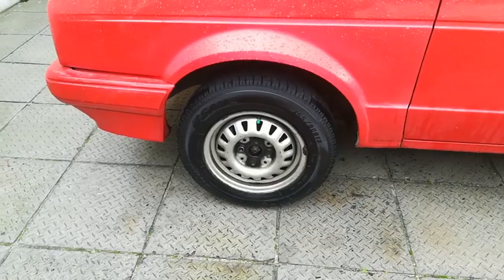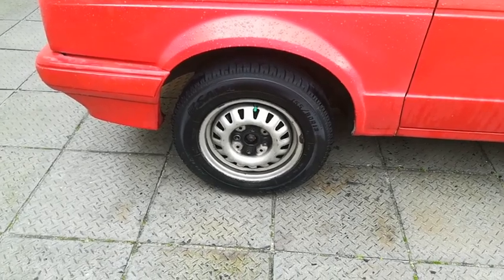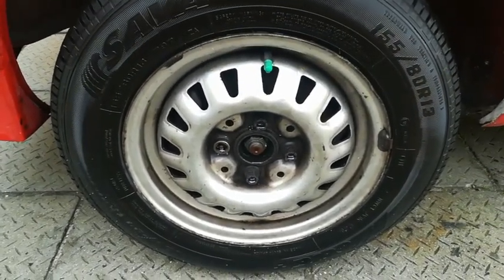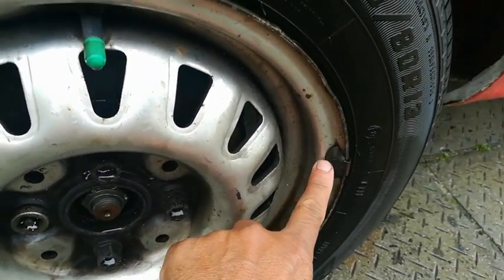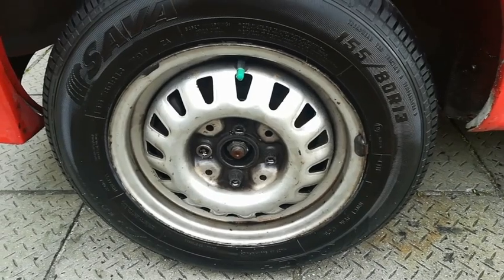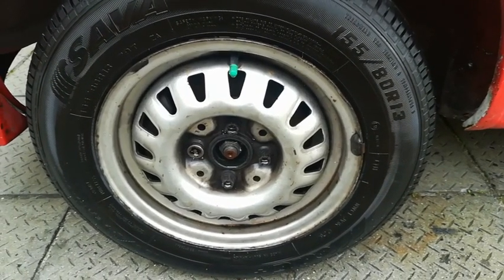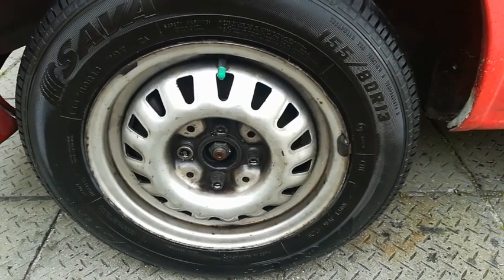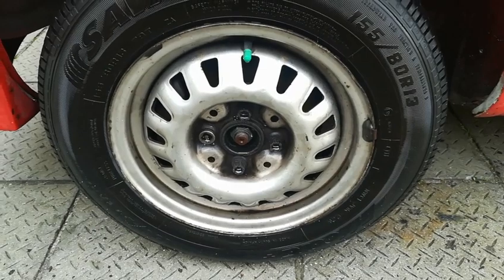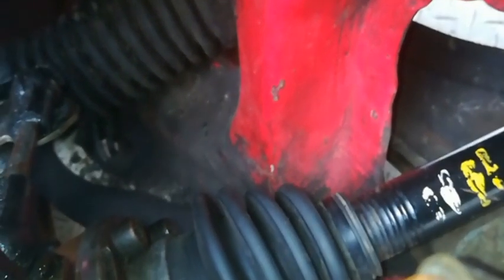One of the first things to check when you have that shaking or vibration on the steering wheel is your wheel balancing. As most of you will know, fitment centers put the wheel on a machine and balance it using small weights that make the wheel run nice and smooth. These weights can come off — I've even heard of thieves stealing them because they're lead. Once they're taken off, you don't even know it, and then you develop this vibration. Just check if those weights are on; if not, take it for wheel balancing at a fitment center to confirm both sides are balanced.